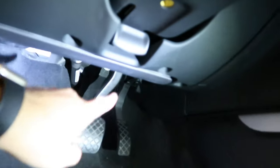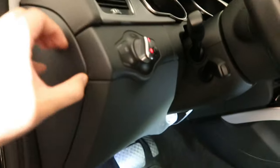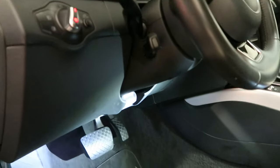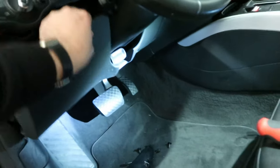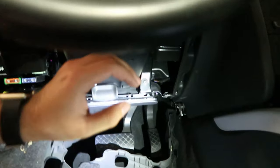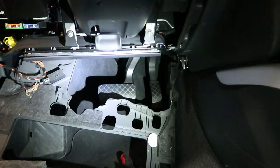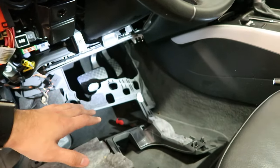So pretty much what I'm doing currently is removing the bolts from under here so I can get to the plug for the pedal. I've removed four bolts — there's one right here, two right there, and there's one over here, plus one behind this. So five total. Then just go ahead and pop this off. For this side, it's a little bit tricky. You're going to want to pull down from the back first, try to push that down, and then the top will kind of slide out as well. Don't try to force it, just wiggle it out. Don't pull hard because you might break some clips. Everything should slide out pretty easily — it'll just fall down pretty peacefully. Go ahead and lay this down. There shouldn't be any cords being tugged or pulled.